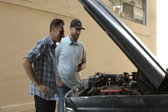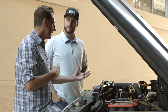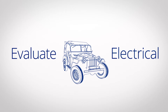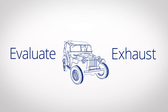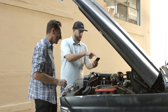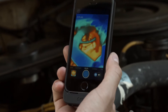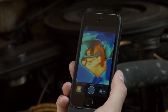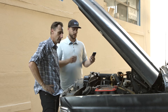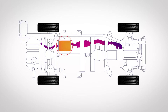Wow, it's a beast. With thermal imaging, the idea is to look for any irregularities with your coolant system, your electrical system, and your exhaust system. Just looking at it right now, you can see a lot of the heat coming off the exhaust manifold here. If you've got a block or a leak somewhere, you're going to see it instantly. You could jack the car up and look at the entire exhaust system all the way back. You could put this on a lift, start the car up, and see the whole exhaust system heat up.